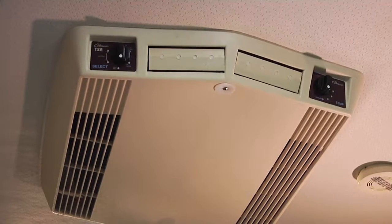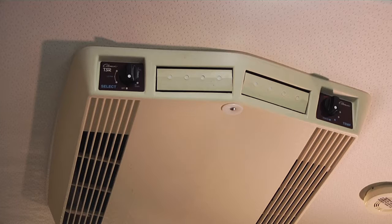If I just tell somebody that I don't think my air flow is coming out enough or my air conditioner isn't cool enough, that's a little too general. So I want to periodically test the air flow and temperature. If I see it start to decrease, I probably need to change my filter. If the temperature is going up and it's not cooling as well as before, I'll need to take it to my dealership and have it recharged.